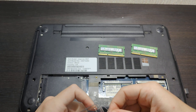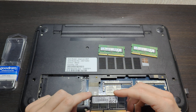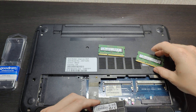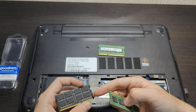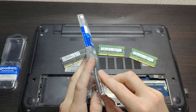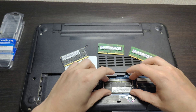The new RAM has the same characteristics — DDR3, PC3L — just with a higher capacity. The voltage is 1.35V, which is low voltage. You can see the new sticks have doubled memory chips: four chips on one side and eight on the other side. Let's open up the second new stick — we can do it without damaging the box — and install it.